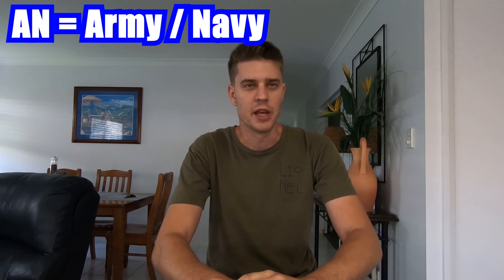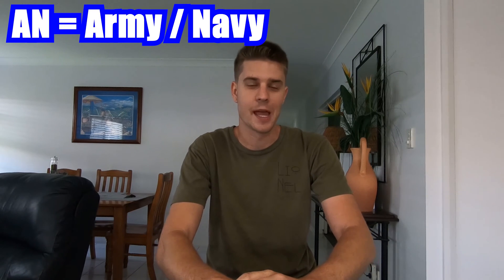AN stands for Army Navy. The US military came out with a standardized size fitting to make lives a bit easier for themselves. They developed this fitting that we all now use, which has a really good seal and is really easy to work with. What they did was base the whole system off a sixteenth of an inch. To correlate this you're going to need some knowledge of fractions — I'm not here to teach fractions, just to get you to the right sizes. The AN system, often abbreviated to dash fittings — AN and dash fittings are exactly the same — is based off sixteenths of an inch.